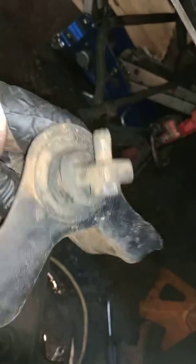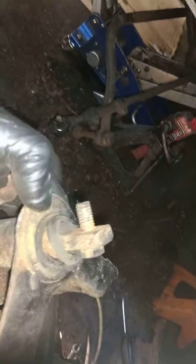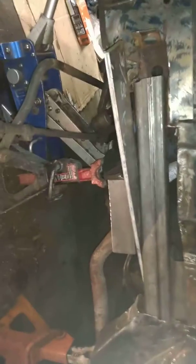It's basically two half bushings that are polyurethane and are going to be a lot stronger. I have to look at some other videos to see how they did it, but basically I gotta melt out this bushing, keep the metal part, and hopefully it'll work out good. As much as I want to do both sides, I don't know if I'll genuinely have time, but we'll get to the other side — it's not a big deal. Right now this is not worth not doing.